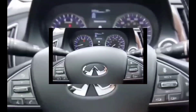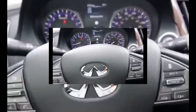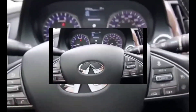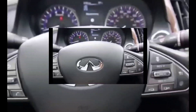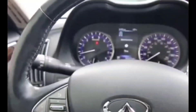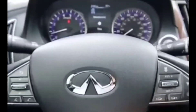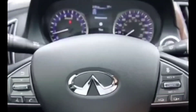If that doesn't work, on some cars — particularly Nissans — there is a slot for the key fob. Just look for it; it's normally on the left-hand side of your steering wheel and it'll look like a little square slot. You can pop your key fob in there and try to start it. The car itself will actually send out more of an electrical pulse to the key fob in that slot.